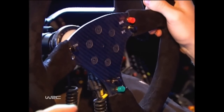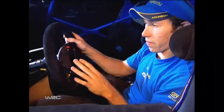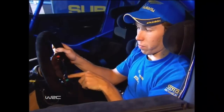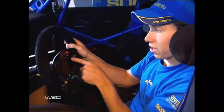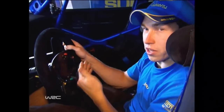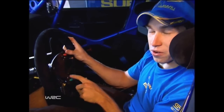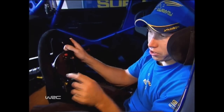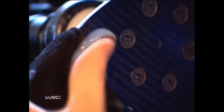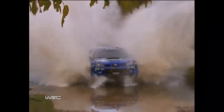As you can see here, this is the steering wheel of the Impreza World Rally Car. It's actually made of carbon fibre, so it's lightweight, which is good for the centre of gravity because it's quite up high. There are a lot of buttons here. We've got a washer and wipe and a marker button, which helps the engineers — if we have a problem with the car we can press that red button and it will put a mark in the data. The other two are for our headlights and our launch control, which we use at the start line. Generally during the stage you don't use them much — just the washer — but Glenn's also got them on his side so he can use them if we have some mud come on the windscreen.